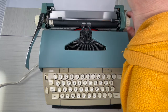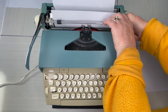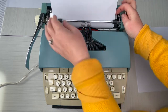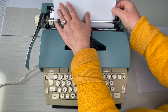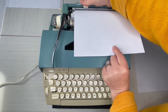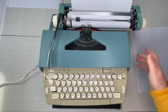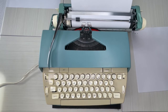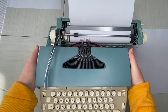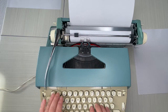Okay, for the typing demo: you set the paper right there — no need to press it down, just set it and then turn the handle and it pulls it right through. I like to come halfway to make sure it's even. If it's uneven, bring it forward, get those lined up, re-engage, back down, check your margins, and bring them in a little. Then turn the typewriter on and move this forward just a tad.